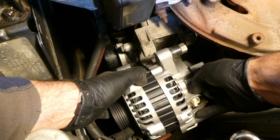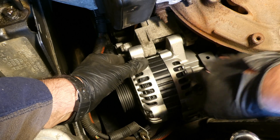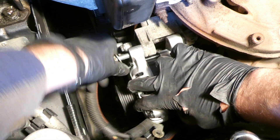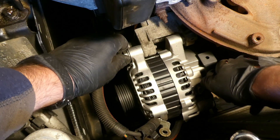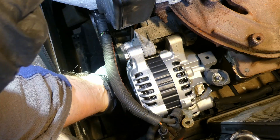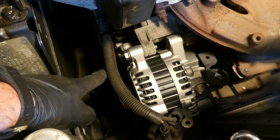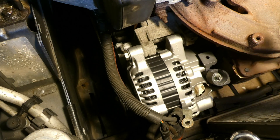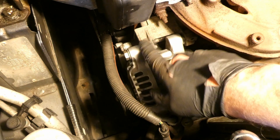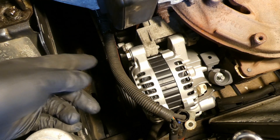The two bolts both slot in — the top bolt is inside and the bottom is also inside. It doesn't move now. Put the upper bolt in properly, then the bottom bolt. Pre-tighten those on the right and at the bottom, then torque them all up. The torque spec is 40 Newton meters, plus or minus one Newton meter.